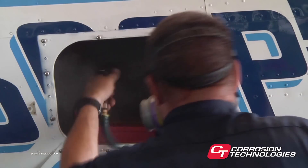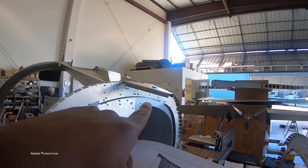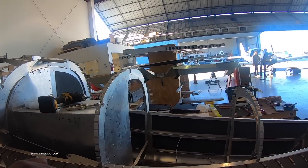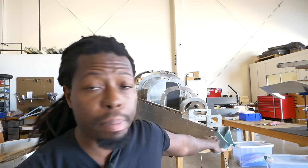I spoke to a painter — specifically the person who's going to be painting my airplane when it's done. As you've followed along with my build, you've seen I haven't really applied any primer solution yet, and I'll tell you why. If you want to prime material, first you put in a filler, apply the primer, and then in some cases you may have to wait a few days, let it dry, come back and sand it to have a smooth surface, and then apply paint. This is typical for the outside skin of the aircraft.